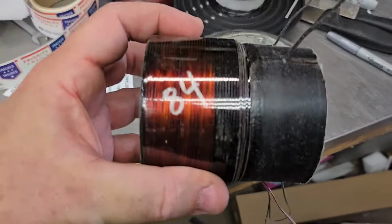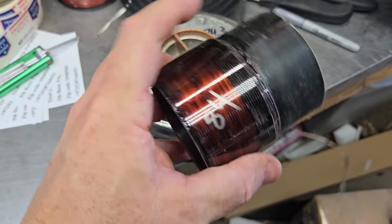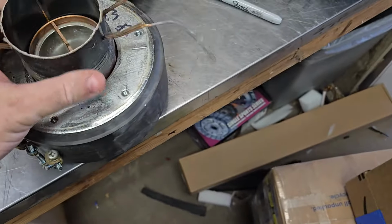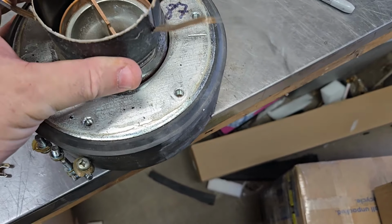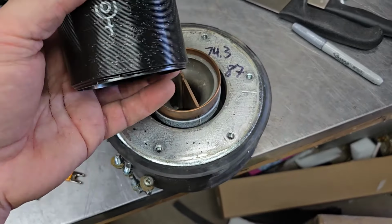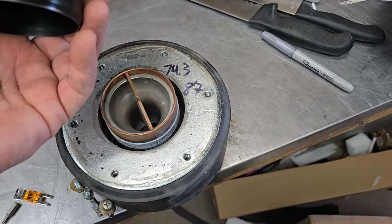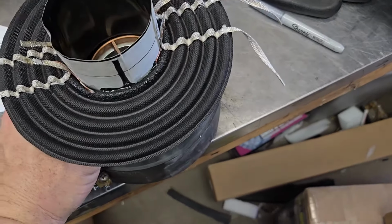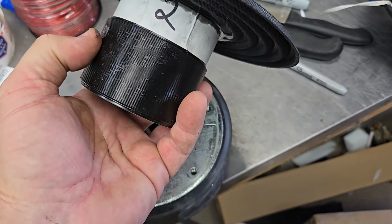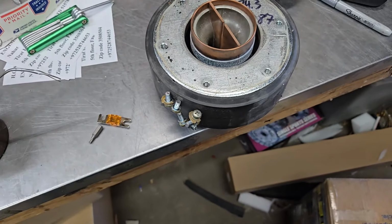The closest thing I have right now is probably this one, which is the Phi knockoff. It's an 8-layer bifilar flat aluminum. This one is dual half ohm, and as you can see, it's still a little gappy in there, but it's good enough. So this one I'm using is a 50 millimeter wind height, all copper. It has an OD of, what did we say, 82 millimeter. So it's a little gappy, but I'm hoping that the copper will add a little more thermal mass, and also this heat sink that's in there will add some.